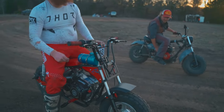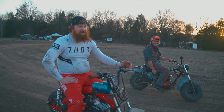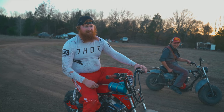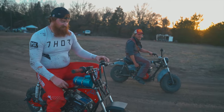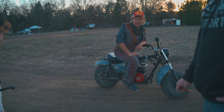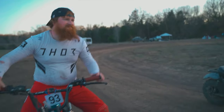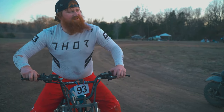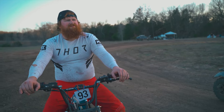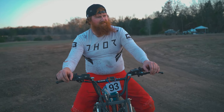I just got to get the frame. I knew they were going to sell fast, so I just bought the rear suspension kit. I was like, I don't have the frame yet but I'm going to go ahead and buy it because I knew they were going to sell out — like that first weekend. Looks like you got the aftermarket weights in that juggernaut. Yes, it's got the glue on it. It stalls at 2,200. Stock is 2,500 — I think it's 3, either 3 or 3,500. So it's kind of quicker off the line — gives you a little more in your power band.